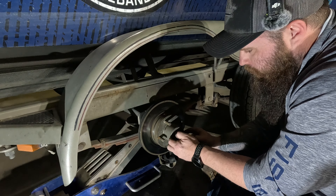I'm going to need my wonderful assistant to grab me a flat screwdriver. Remember, don't use your screwdrivers as pry bars — get the correct tool. Do as I say, not as I do. Save this retainer clip, you're definitely going to need it again. Now this nut was normally going to be finger tight, and that is the indication of the play that we found in this hub in that earlier video. Also save this nut — we will clean it up before we put it back on.